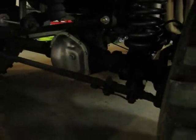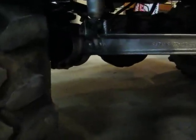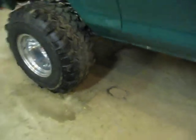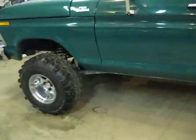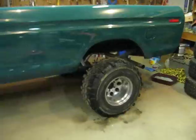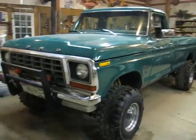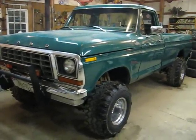I've done quite a bit of work. I put some new bushings in — got that bar painted up and put the new offset bushings in for the lift kit. They were 7-degree offset bushings, so I went ahead and put them in. Got about an inch of lift in the front extra when I put them in, because the old ones were worn out. Just a quick little update on the old '78 Ford pickup.